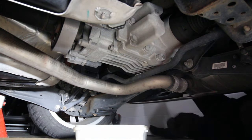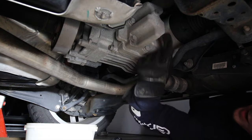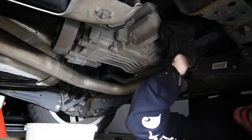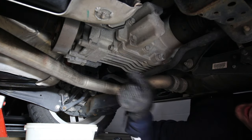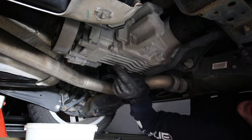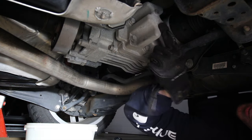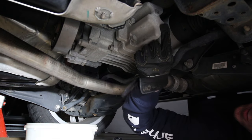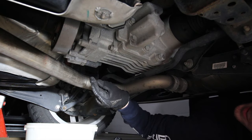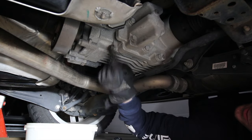Here's a little overview of what we've got going on. Right up here on the side of this little protruding object on your rear diff is going to be the fill plug for your Haldex. It is very important when you're doing anything that has an upper fill plug and a drain plug — like differentials, transmissions — that you make sure your fill plug comes off and that you don't strip it. Because if your fill plug doesn't come off and you drain all your fluid out, you're not putting fluid back in, and then you've got bigger problems.